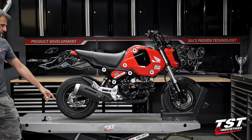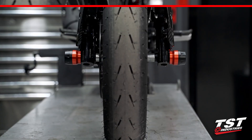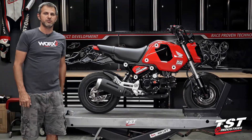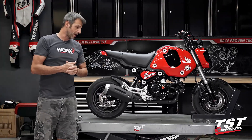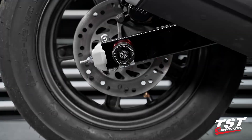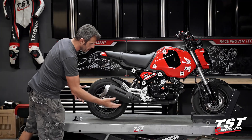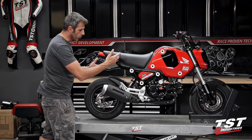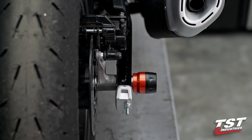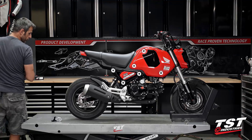As you can see on the axles — front and rear — we have our axle sliders. We've been making these for a number of years. They are comprised of an aluminum base and a Delrin puck. They are very effective, and some tracks actually mandate that you use them so you don't scrape up their concrete or pavement. They've proven very effective in protecting vital elements on the bike — obviously not your exhaust since that hangs out too far — but rotors, fork bottoms, calipers, things like that are protected from scrapes and damage due to crashes.